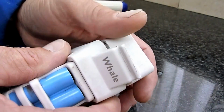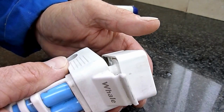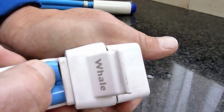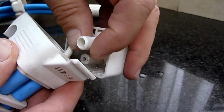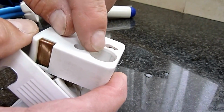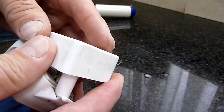Of course you switch your pump off, or I switched my pump off when disconnecting to refill the water tank, and switch it back on again when you get back inside the Caravan, and unless you can hear the water pump just freely running, then you end up with the same situation all over again. So what we've got here is the tubing should be connected to this, and then a rubber O-ring on the Caravan side creates a seal, which may need changing occasionally. In fact, it benefits from just lubricating with a bit of water before you make the connection to the Caravan.